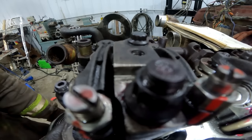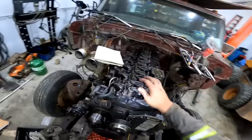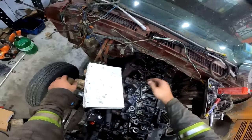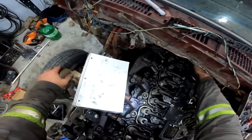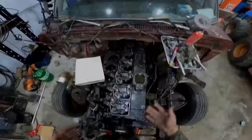All right, so you see the exhaust valve coming up. Intake's about to start opening. See the intake starting to move? So now you're on overlap on number one. Starting from number six hole, number six should be loose. There you go. So now starting on number six, number six on top dead center. So both intake, both of these, now you go intake, exhaust, go. There you go.